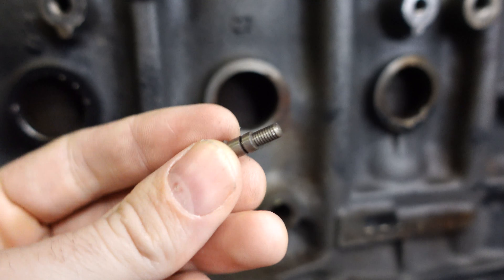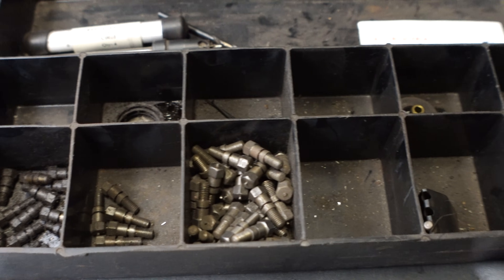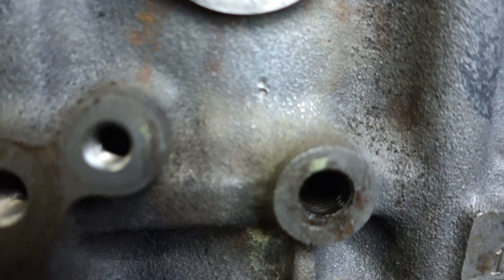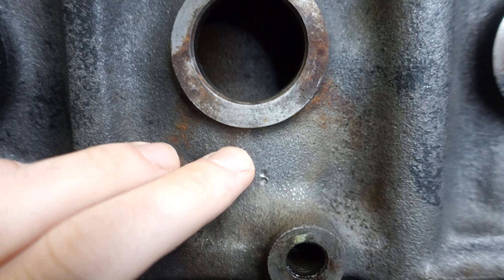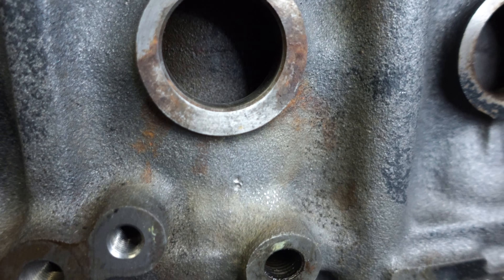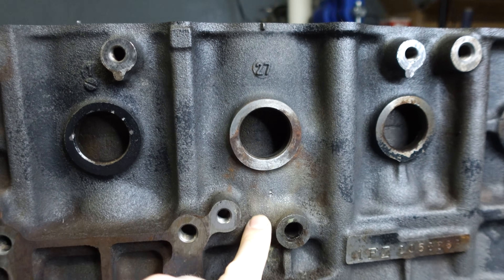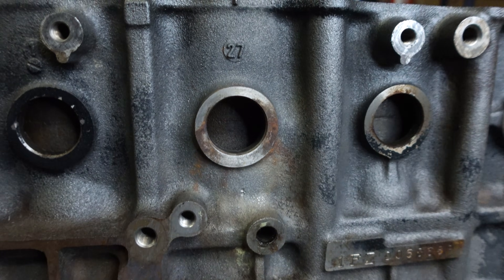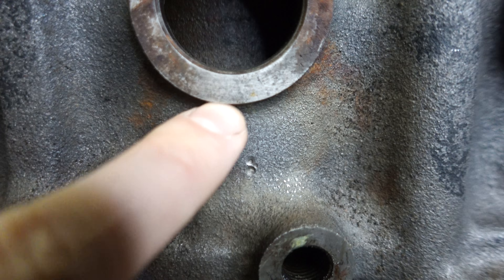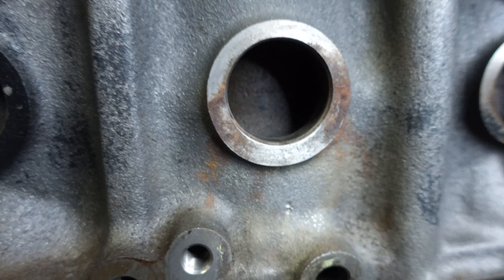The machine shop gave me a used lock and stitch kit, and basically these are pins that are going to go all along the crack and seal it up. I've never done this before — it's going to be my first time. I did a lot of back and forth wondering do I even fix this crack or just leave it, because it's a really small one. But what if I put the whole engine together and it starts spreading? With heat it expands, so I'm going to at least do from right there to right here, and if I feel brave I might get into the freeze plug area.